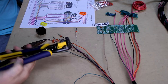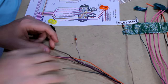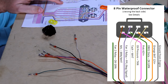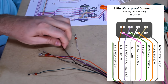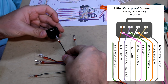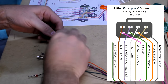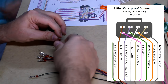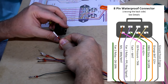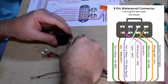With special tool number one and special tool number two, we were able to get all of those connected. Now we're just going to follow our plan - I'll put that on the screen. Let's start with the bottom right, which is a black ground. Here is our black ground. We're going to hold this connector like this and this goes in the bottom. You've got to orientate it with these little teeth right here up. Click - perfect. That was just way too easy.